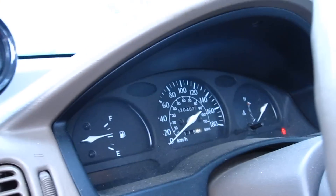The white one is actually for illumination — it's the dimmer fuse and that's basically hooked up to this dimmer switch right here which controls the dimness of the lights. So whenever I dim the switch, the gauge dims too. You don't necessarily need a dimmer switch or even have it on a dimmer, but I just did it anyways since I had access to the fuse right there. So if you don't want to use a dimmer, link it to your positive ignition wire.